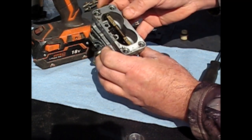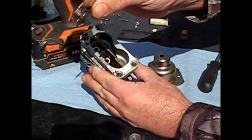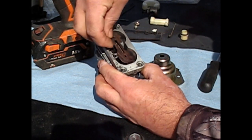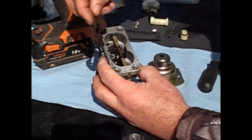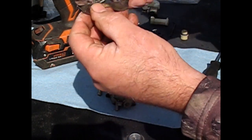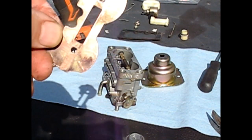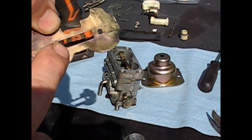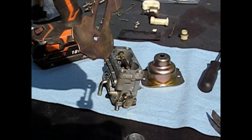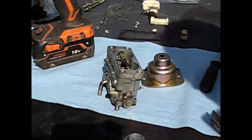Put that back in there. The only thing that holds this is going to be the plates. There's little screws and it'll hold that. I just have to figure out which way it was. I do have pictures if necessary. Usually you can look at things like this and you can find witness marks. For example, on mine, you could see the line where the bar was. So the bar was on that side. The other side, you don't have anything. So just look for witness marks.